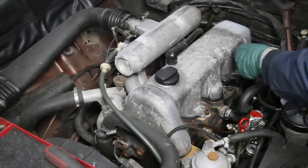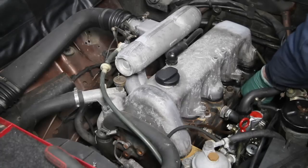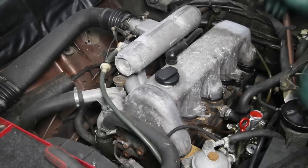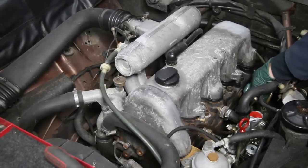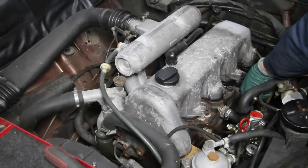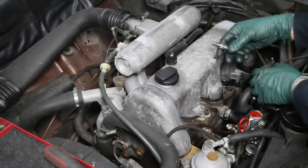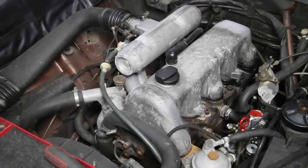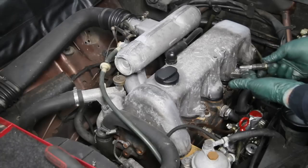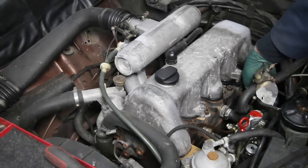But while I'm at it, I think I'll go ahead and just ream out the carbon in the pre-chambers. We have a special reamer that we make right here in my shop. We're going to stick this reamer in and see if we get a little bit of carbon — I can feel it. Now if it's real bad, what I'll do is take and put a little grease on the flutes of this reamer. It's binding up in there so I think we'll go ahead and back this back out. You can see the carbon I'm picking up. So I'll wipe this off and put some synthetic grease on there so any excessive carbon will be picked up by the grease.